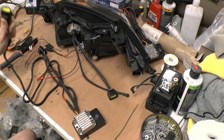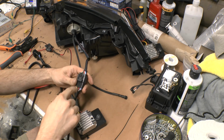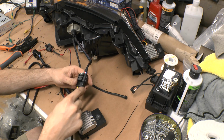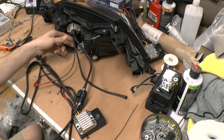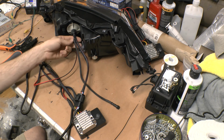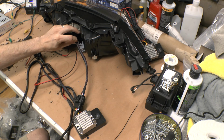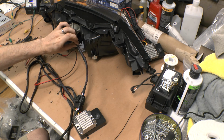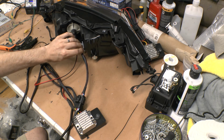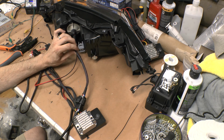So yeah, you're going to want to check your connections. Obviously a lot of this is going to be making sure that you do the right connection of wires. It does not ultimately matter what order you put yours in, as long as it's the same on the connecting wire. You'll see on the headlight here, I wasn't really going to go over the actual wiring of the headlight, because that just all depends on you. But basically I have my JST in, which is like 3 wires going in for the JST. I have my 5 wires for the RGBW, and I have my trigger wires. On the battery side, I have a DRL and a turn, and on the non-battery side, I will have just a turn signal wire.